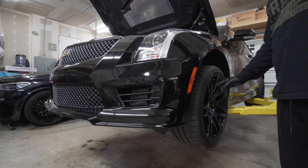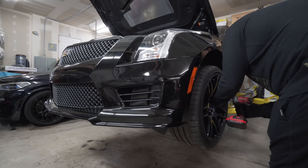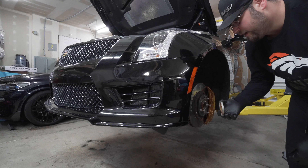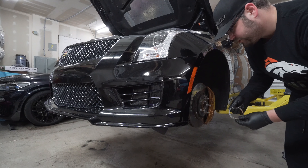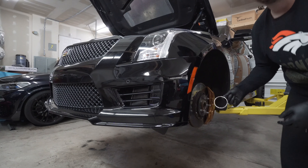The car is already lifted and now I'm going to remove all the wheels to get access to the brakes. Some wheels will have what they call a hub ring — you'll need to remove that as well, since when removing the rotor it'll slip on the hub and sit on top of the rotor. Make sure you keep it with your wheel so you don't lose it.